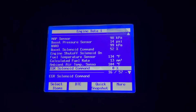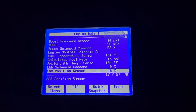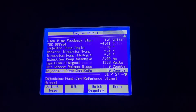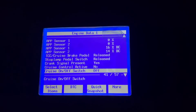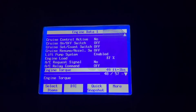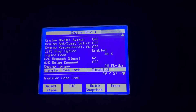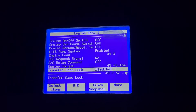Ambient air temperature sensor — that is definitely not the ambient air temperature right now; it's about 82 degrees outside and it's reading about 104. It's November in Austin, Texas. EGR position sensor, glow plug, TDC offset — these are all good data to look at as you're troubleshooting different things. Do we have a throttle position sensor in here? Cruise control active/not active. AC request signal — my AC's not working, which is another thing I have to troubleshoot. I wonder if I turn it on, does it do anything? Nope, not doing a darn thing. I bet I have an AC relay or a fuse or something. We'll troubleshoot that later.